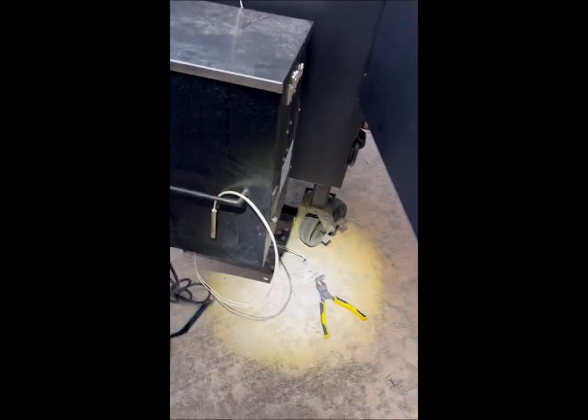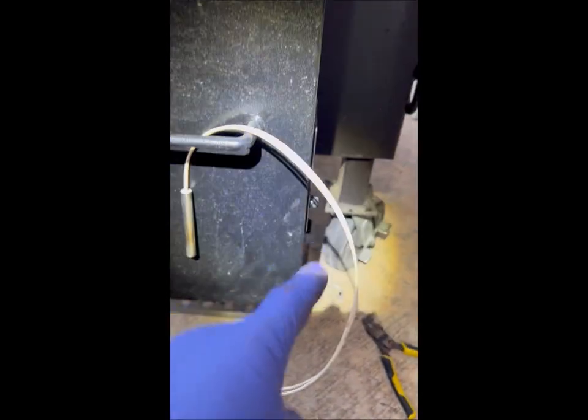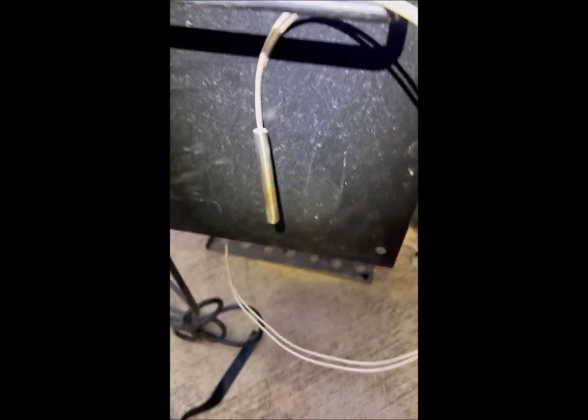Now I've got to find the hot rod because I've pushed it back up in there and I'll have to fish it back out. Normally the hot rod is just sitting right there. I plugged in the new hot rod, got up under here, disconnected the old hot rod, and plugged in the new one. I hung it right here and turned it on to make sure it gets hot — and it was getting hot. So I pulled the fuse and shut it back down to let it cool.